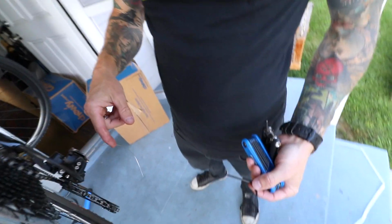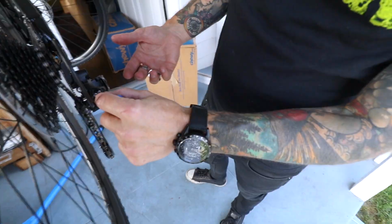The screw that's on the left side controls how far your bike goes away from the spokes. And usually, some derailleurs actually come labeled with an H and an L. Oh, really? So you can see what's high, what's low. Oh. This particular one, not labeled.